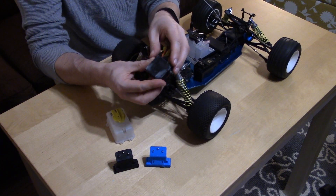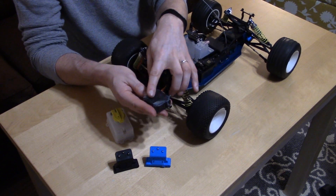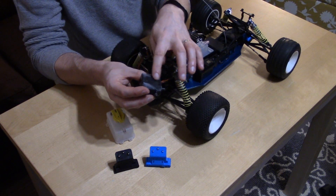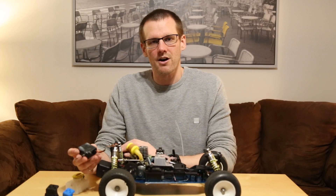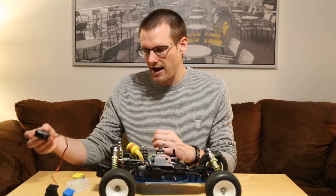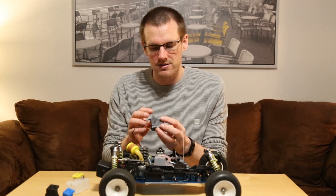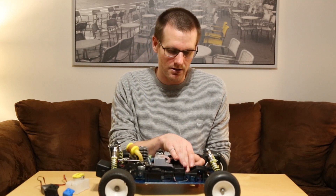Turning this servo over gives away the reasoning as to why it failed like that. It's a very rough surface — you can see the servo actually changed color and is quite rough. From this I know it was in contact with nitro fuel on the vehicle, and because of that it ended up destroying the plastic. There's no way to save this, so what we ended up doing is replacing that servo entirely, replacing it with just a standard servo I probably haven't used for 15 years.